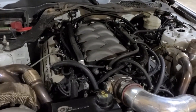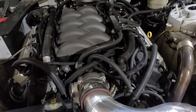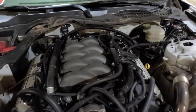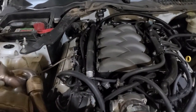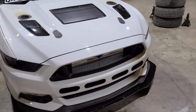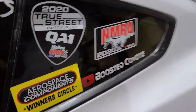It's making around 1,200 wheel or so on the higher boost — that's around 22 to 23 pounds of boost. I can keep going up with the boost controller, but the higher you go, the higher the risk of breaking a factory sleeve. So for now we're going to go ahead and take it for a drive and show you what it does.